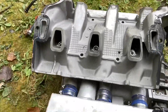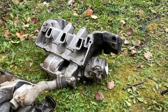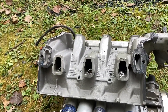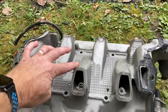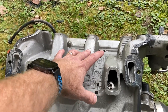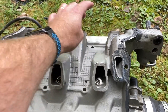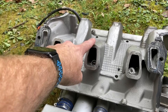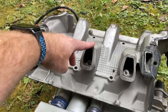There were some differences compared to the 3400. It definitely flowed better than the 3.1, but it still wasn't as even as I was hoping it was going to be. Between the 3400 and this one, numbers 1, 2, and 3 were almost the same. Number 4 dropped off quite a bit — it was down to about 8. But 5 and 6 picked up over the 3400. So 5 and 6 were flowing better, but 4 dropped off, which is surprising.